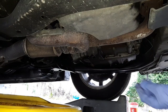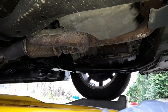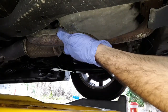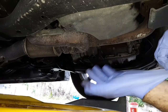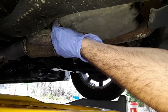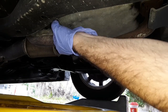All right, we'll let the engine idle 10 to 15 minutes and it'll circulate and clean everything. I actually cracked the bolt loose off camera because it was really, really tight. I thought I was going to smack the camera when it finally did come loose. Wear gloves because this oil is going to be hot with the engine having just idled for 15 minutes.